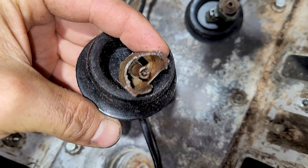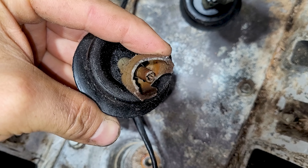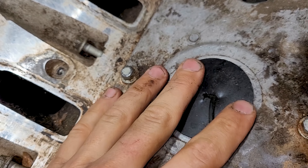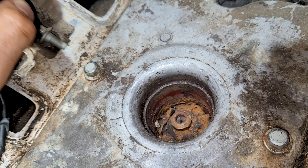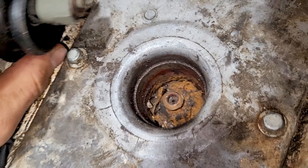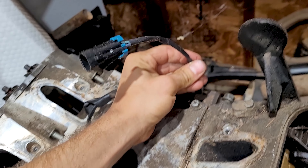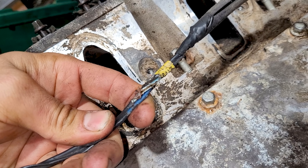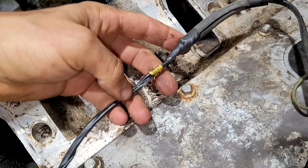If you have to take everything apart, here's how to test the knock sensor wiring harness. I've got the wiring harness right here. You'll see right here is where it clips into the top of the knock sensor. The plastic always breaks and the connection gets all nasty and corroded — it doesn't read right. It's got a little rubber seal around it, but it doesn't do much. They designed it as a rubber cup that's supposed to fit down and seal up, but it doesn't seal well because it turns brittle with all the heat, then gets condensation and water in there, ending up with a rusted connection and a rusted knock sensor. It runs from the sensors back to this blue connector at the top of the engine on the intake manifold.